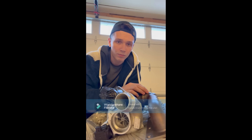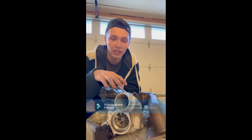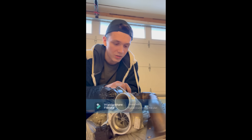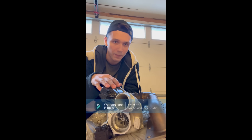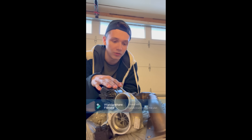It didn't even last 1000 kilometers. The tuning process wasn't easy because the wastegate system on this turbo has a huge design flaw. At first I believed it was just the heat cycles of the brand new turbo settling, or the mechanisms settling into place — but that was wrong. The first sign was that the wastegate system went out of calibration, sending error code 123432, which causes the wastegate system to completely stop working. The wastegate position goes so far out that the actuator doesn't want to work anymore — you have to recalibrate the wastegate system.